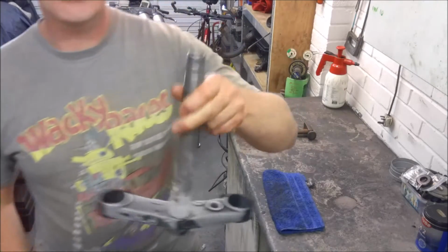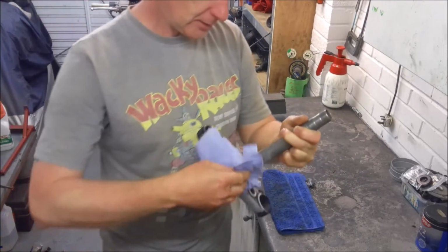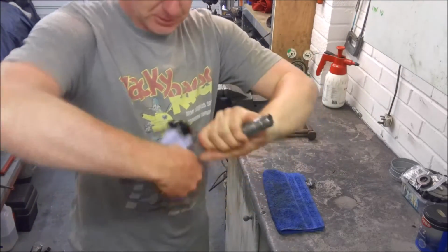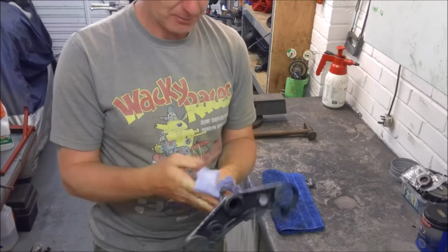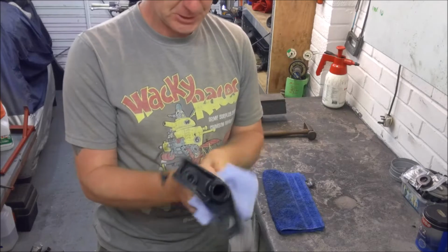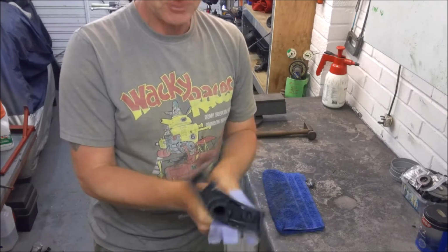So here's my yoke, and you may notice there's a bit of a white coating on it, and that's because this yoke has just spent the last day or so sat in the freezer to chill it down. So why have I chilled down the yoke? Well, obviously bearings are an interference fit,